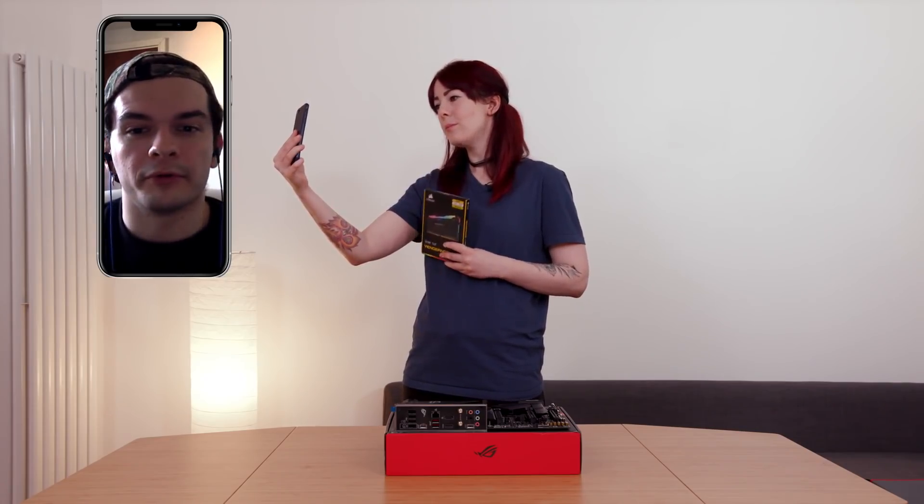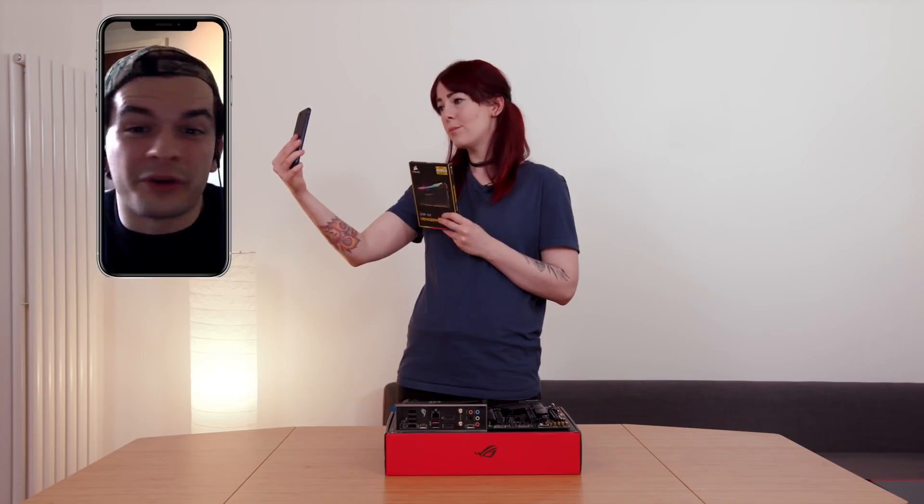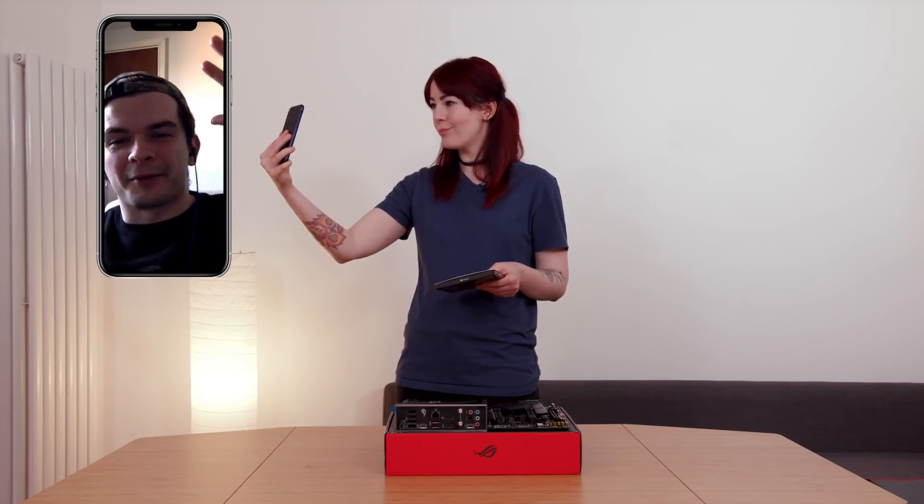Hey mate — I'm a brain surgeon now officially, I've just put a CPU into a motherboard. I've got two sticks of RAM but four different slots — do I just pick the one that gives off the best vibe? This is actually a very common question — it's down to dual channel configuration. You want the RAM in the right slots to get the most speed. Think of it like a bus: both pairs of slots are their own bus, so you want the sticks on their own bus to enjoy the space. For your motherboard it's slots two and four — double check the motherboard manual. Two and four, will double check — thanks, dude! See you later. That's me hanging up.